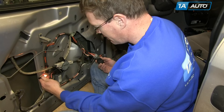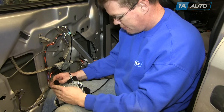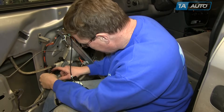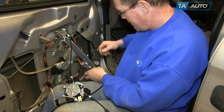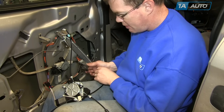I was able to deduce that it was the motor because I know there's power going into the switch, power coming out of the switch, and no breaks in the wires between the switch and the motor — when I flick the switch, I'm able to light up the test light at the connector at the motor. So it has to be the motor that's bad. We can confirm that pretty easily. We've got our new regulator with motor here from 1A Auto. We'll press down on the tab, disconnect, and connect the new one right here. You can hear very easily as soon as we hit the switch, this motor is working.